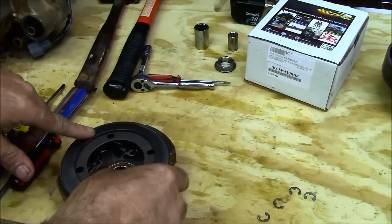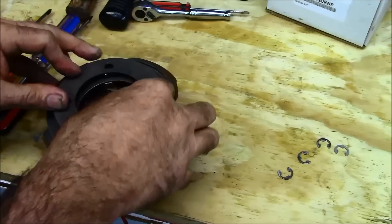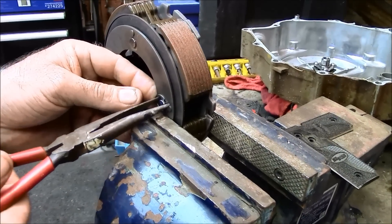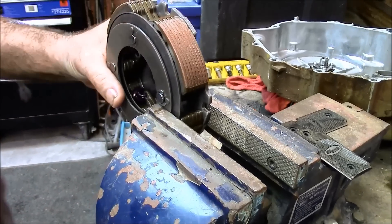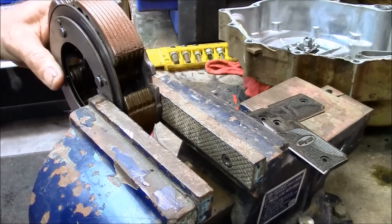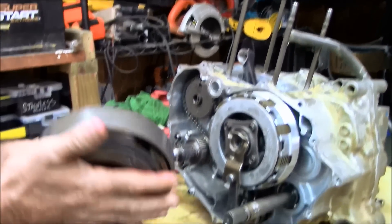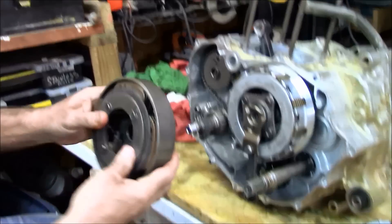Go back with the backing plate. The spring washer is actually a spring — you can see it here — and this goes back on like that. All we did is put the seat clamps back in, those seat clips. Put the vise, tighten a little bit, put the clip on. That's it. Once you have it back together, slide the clutch back in. Make sure that the one-way bearing is working correctly. There's no index on that, so slide it back on very carefully.